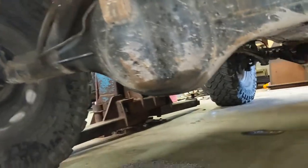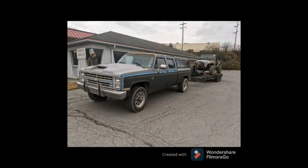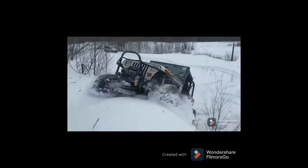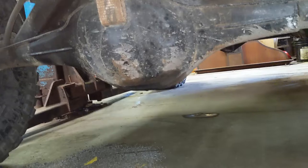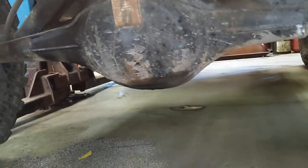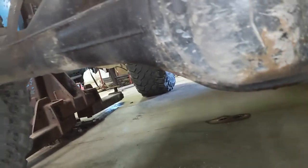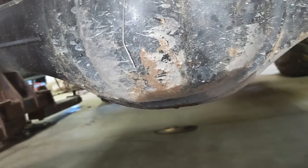I've been wanting to shave this 9-inch for quite some time, so it looks like now's the time. I'm going to want to take about an inch off of the lowest point on this housing, at least for starters. I want to get it marked at an inch off. We're going to measure while everything's on its own weight, so everything is at the appropriate pinion angle. It looks like we're right about 12 inches from the ground to the bottom of the diff. So I'm going to build a contraption, probably just out of a piece of 2x4, at 13 inches, so I can then just scribe a line around the housing that's parallel with the floor to at least get me a starting point.